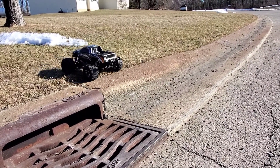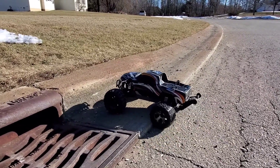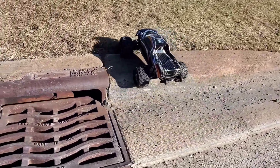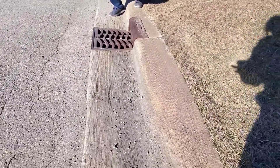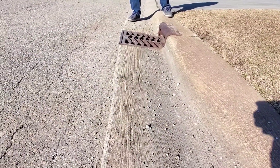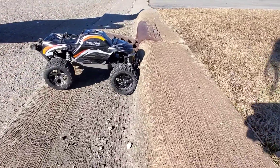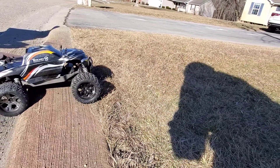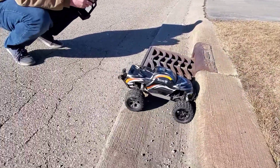What a night and day contrast. I've got a 54-tooth spur gear and 13-tooth pinion gear, so this isn't the ideal crawler setup, but it's amazing how you can just easily walk up anything with no cogging. It makes it such a great all-around vehicle — more torque, more top end, with the sensored crawling capability. That is something the Velineon setup could never do.